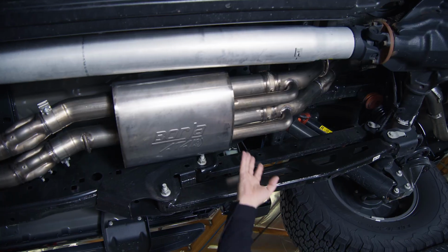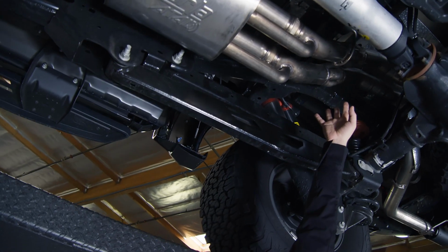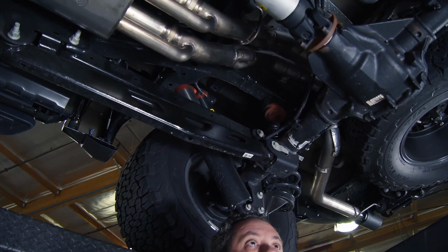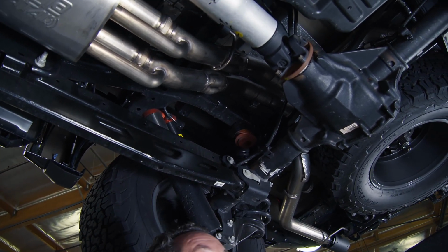So we have our own patented crossover design called Switchfire. We elected not to use it. It just seemed like whatever kind of crossover pipe we put really made it sound very smooth and very sports car-like. So we do not have a crossover pipe in our system. As you move further back here, this is the second set of Polyphonics technology. Again, different lengths and diameters inside of there based on organ pipe formulas to create harmony, very much like a power chord on a guitar.